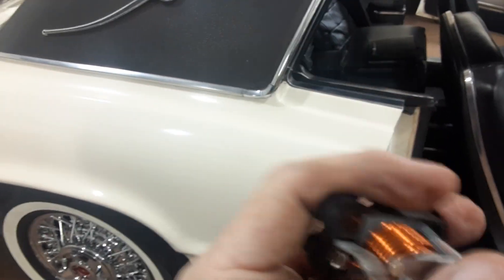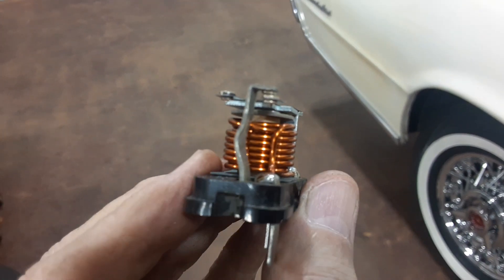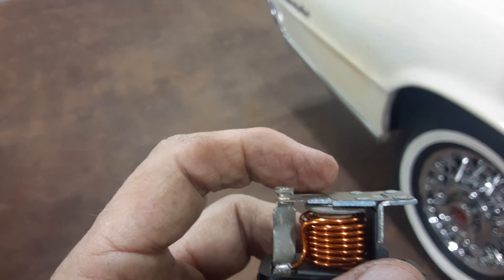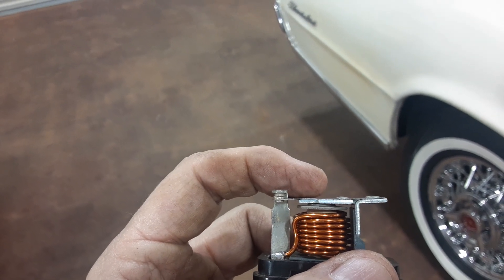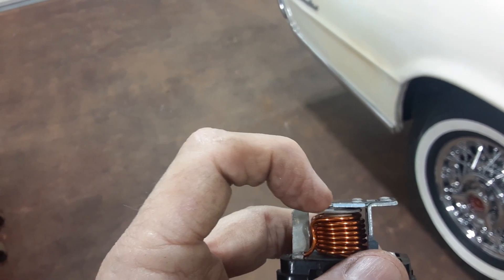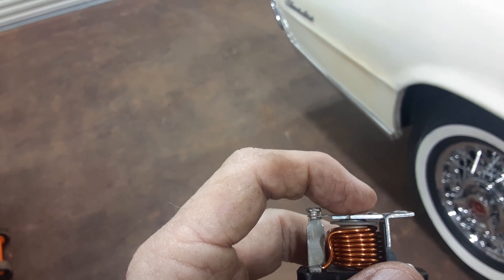What I've got here is the relay. Flip it upside down and you can see the vertical post right there — it has a bend in it. Since there's less current going through here, my theory is there's less magnetic force to pull this down, so the gap between the coil where it becomes a magnet and this top piece of the points — I made it about half the amount or so.